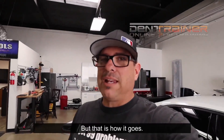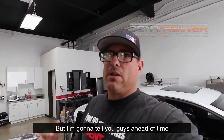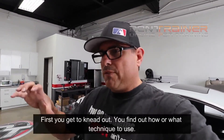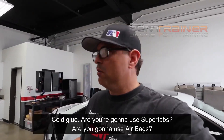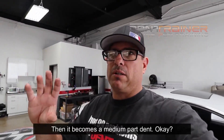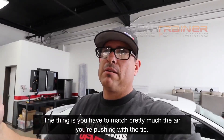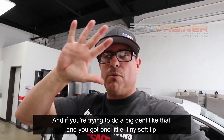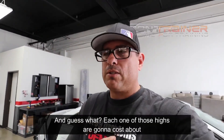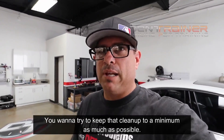I don't think they realize that's how it goes, but that is how it goes. To have clean repairs — which we're going to talk about in the second episode of PDR Tool Time podcast — first you get the meat out. You find out what technique you're going to use: cold glue, super tabs, airbags? What are you going to do to get most of the meat out? Then it becomes a medium-sized dent. Are you going to use smaller tabs or a big soft tip with different tips? You have to match the area you're pushing with the tip. If you're trying to do a big dent with one little tiny soft tip, chances are you're still going to create little highs in there, and each one of those highs will cause about 5 to 15 minutes of work each at the end. It's a lot of cleanup. You want to try to keep that cleanup to a minimum.